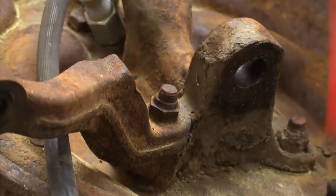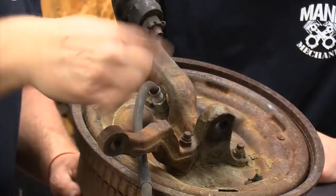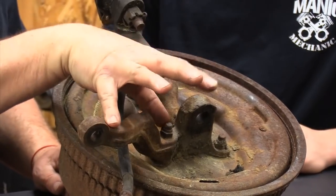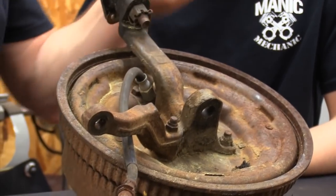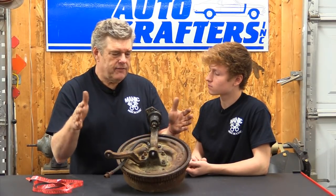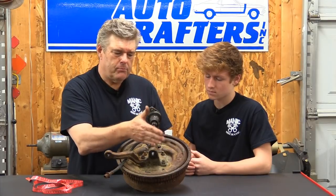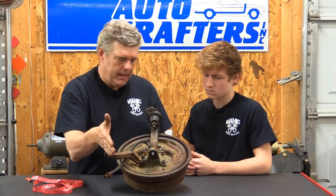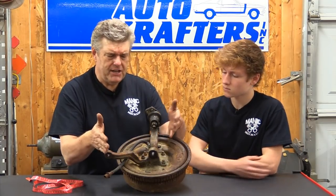The reason you're looking for these measurements is that Ford changed the tie rod position — both in drop and also distance in. The tie rod position moved in and shortened, and that affects Ackermann angle. Ackermann angle is the distance to the center of the rear axle from both tie rod ends, and it affects the way the car steers and handles. Every different make within the Ford line will have a different Ackermann angle and different tie rod positions — a big LTD will be different from a Falcon, which will be different from a Fairlane.